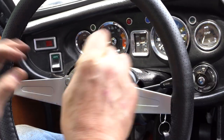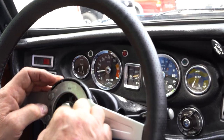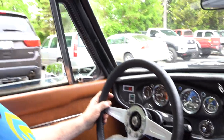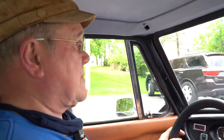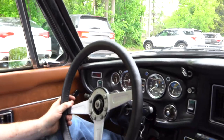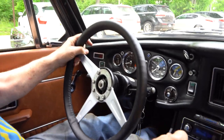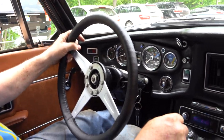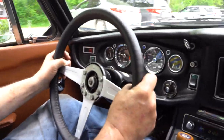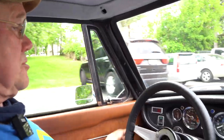And there are only so many splines. And if this doesn't do it, we've got to go back down and turn the tie rods. Now we've already adjusted them so that we're in alignment. But let me watch my rear view mirror here. I think the problem now is that we're canted off to the right. Let's try it and see. So it's, I don't know, 1 minute to the right.